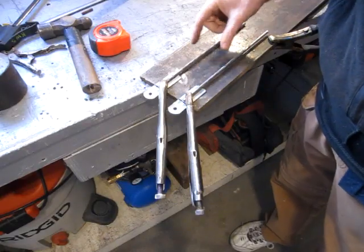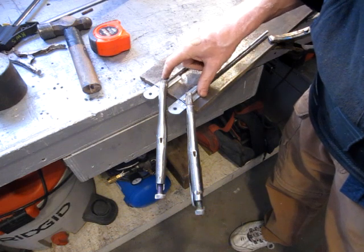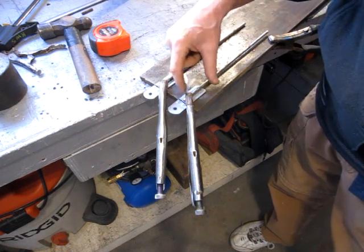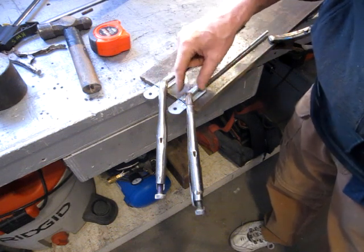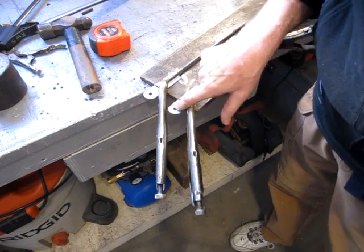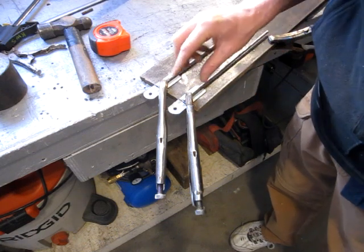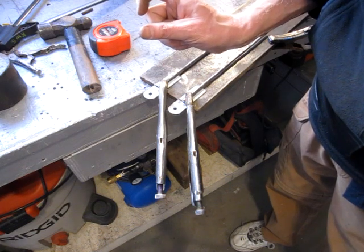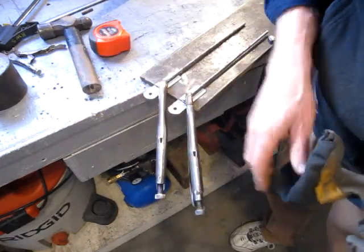The two rear supports are just going to be 1/4 inch rod, and I had a couple of these galvanized brackets, I think off a bed frame. Cut them off, measured down 2 inches, so I'm just going to put some tacks to hold these on, and then we'll screw them into place. Maybe bend the ends a bit because they're going to be contoured just in order to get a, say, a 1-inch weld along the saddlebag frame.